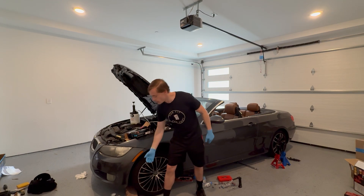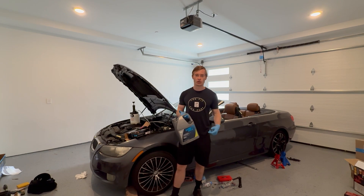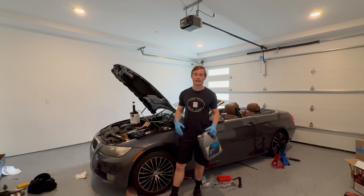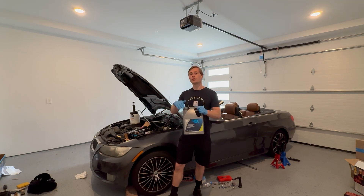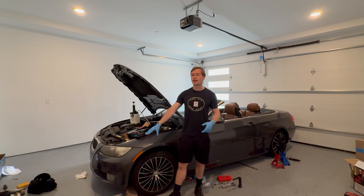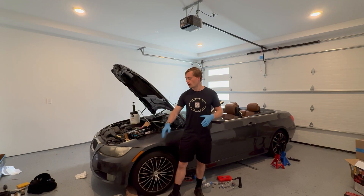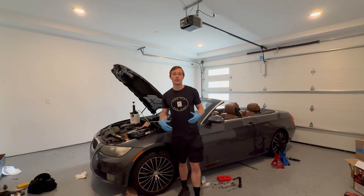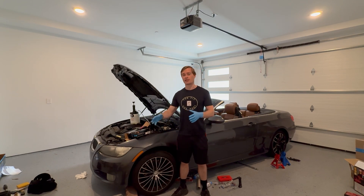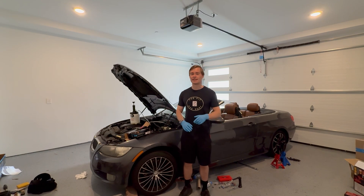The next thing you're going to need, obviously, is some brake fluid. We're going to be pushing this brake fluid up from inside of the slave cylinder's bleeder valve. If you're driving a BMW E90, the brake fluid you want is DOT 4. I picked the Pentosin Super DOT 4 — it's a slightly higher quality brake fluid. This is a 5-liter jug because I was doing bleeds on two different BMWs; however, if you are only doing a single car, two liters will work fine. You don't need to go for the higher quality Pentosin — you could go with any DOT 4 fluid.